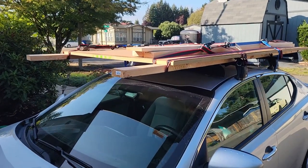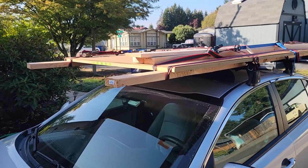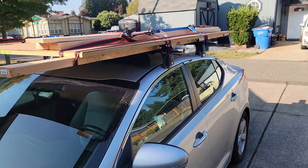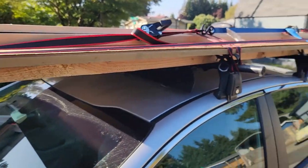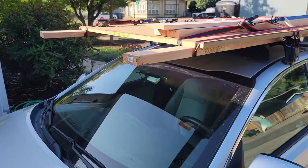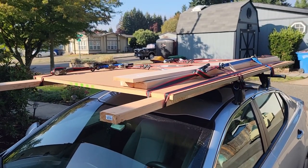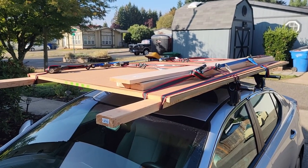Here's the car set up. I got my Yakima racks on there — I carry bikes and stuff, but I've used this for years when I haven't had a pickup truck. Throw a couple two by fours on there, tie that down with some bungee cords. The MDF will sit right on that, won't slide around. Strap everything down, get some longer two by fours and run straps over the top front and back so it won't flop in the breeze. Just can't hold a lot of weight, but it's worked well. One of these days, maybe I'll get a truck.